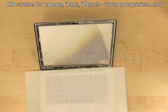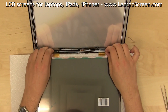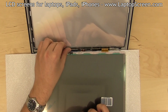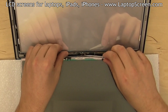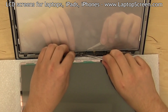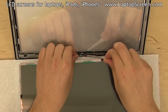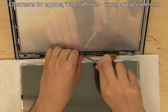Line the keyboard with a clean paper towel and unpack the new LCD matrix. Place the new matrix facing down on the keyboard, gently bend the LCD board forward 180 degrees, and place it directly above where it would normally mount. Feed the backlight flex cable into the gap between the LCD board and the panel, making sure the backlight connector tab is open. Slide the flex cable into the connector, making sure it's in all the way, and close the securing tab.